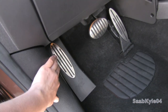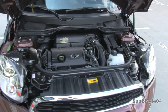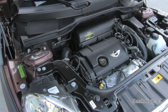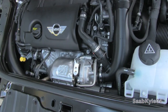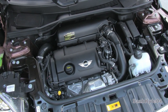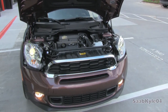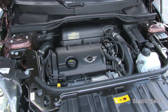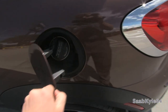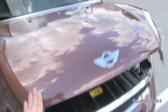We're going to pop the hood. In the U.S. market, all MINIs come with a standard all-aluminum 1.6-liter dual-overhead cam 16-valve four-cylinder and can be had naturally aspirated or turbocharged. The Cooper S, as we see here, is the turbo variant. Base model cars produce 121 horsepower and 118 pound-feet of torque, while the turbo kicks out 181 horsepower at 5,500 rpm and 177 pound-feet of torque as low as 1,600 rpm. Using the car's sport mode dials up the overboost in the turbo to temporarily increase torque up to 192 pound-feet. This leads to a manufacturer-claimed 7.5 seconds 0-to-60, with an approximate quarter-mile time of 16 seconds at 90 miles per hour. Standard cars are front-wheel drive while all-wheel drive is an option. As far as fuel economy, with a 12.4-gallon fuel tank on required premium fuel, expect around 26 city and 32 highway.